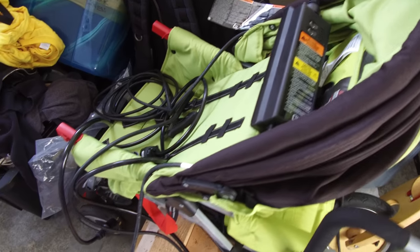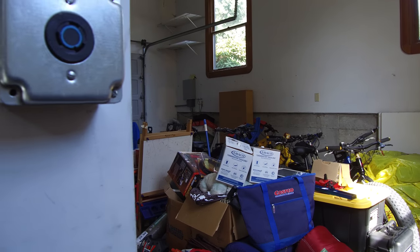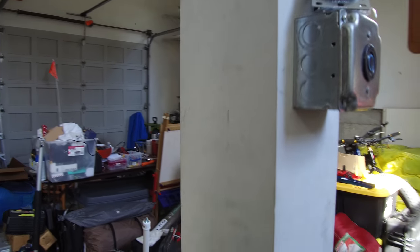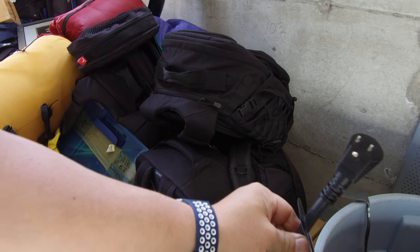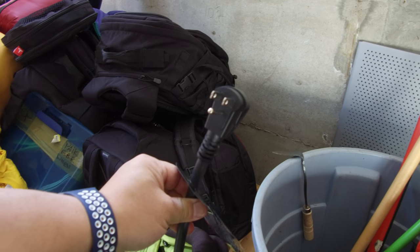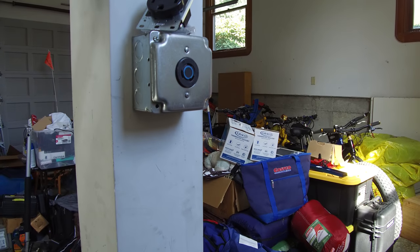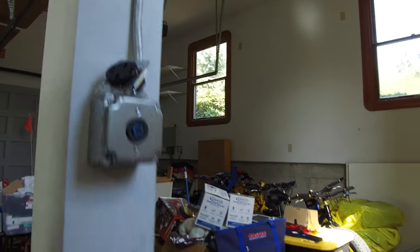So that's really cool, and I wanted to try this out. I happen to have an outlet here — this is a 240-volt 20-amp outlet, an L6-20. It's only 20 amps, so this can handle up to 16 amps pretty safely, and since this is only 12 amps, this is a great fit. The only other issue is the EVSE has a standard 120-volt plug, so I need to get from this standard 5-15 plug over to the L6-20. What I did was I went out and built an adapter — one end is the 5-15, and the other end is the L6-20.